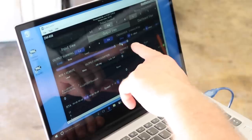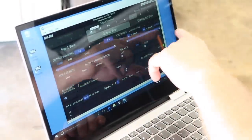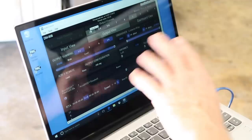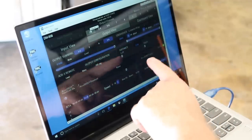So this is the sound that the sub will play. These are the sounds that the rear will play. And then the fronts are basically the same. And there again, we've talked about why we pick 80 hertz. It's just a default. That's probably not where it's gonna stay. It just gives us something to set up so that we have a starting point.